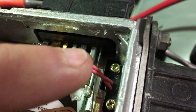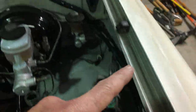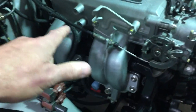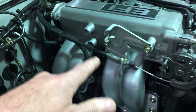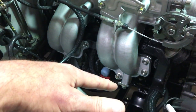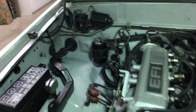Pin number 2 has got to have a path to ground. That means this harness right here, all the way around your firewall, loops over and gangs in under here. There's a splice point in the harness up under there where that brown wire from your airflow meter comes around and grounds out right there. That wire also splices in over here and runs back into the kick panel to your ECU.